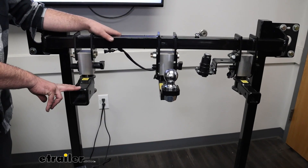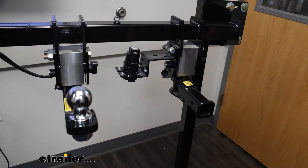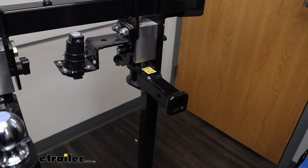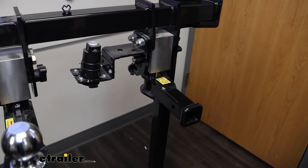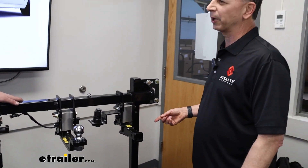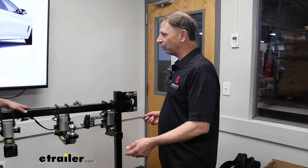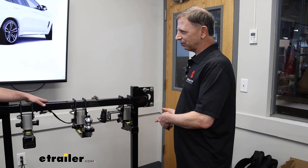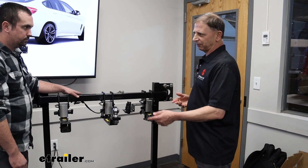So we have our two-inch receiver here and our ball mount. I see a one-and-a-quarter inch — is that available to drop into all the rack receiver kits as well? Correct — our standard kit comes with a two-inch, but you can substitute the one-and-a-quarter, or buy a separate one-and-a-quarter. Some people have both because they have a luggage rack with a two-inch and a bike rack with the one-and-a-quarter, so they can swap back and forth. It gives you more options.